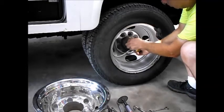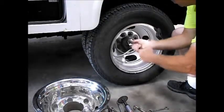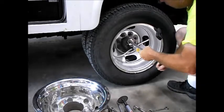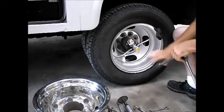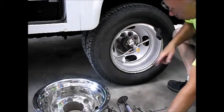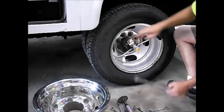Tighten this up, center it where you like it, and torque it down. That puts the crossfire generally right in the middle. Now if you have difficulty tightening these nuts up on these hoses, what you can do a lot of times is put the hand holes at the 3 o'clock and 9 o'clock position so they're across from each other.